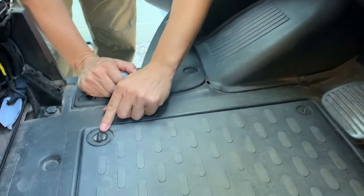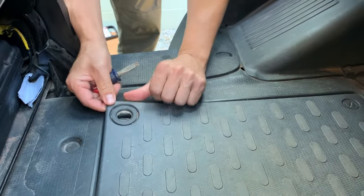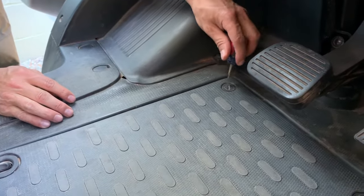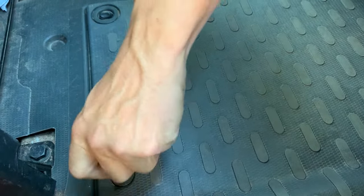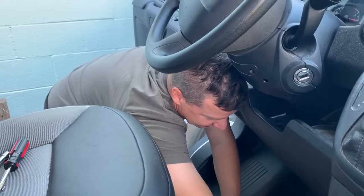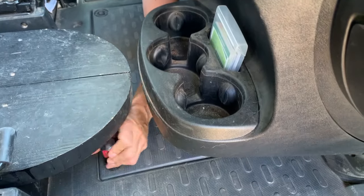The first thing we need to do is locate the battery. It's on the driver's side on the floor, and we're going to remove that cover so we can access the battery. The only tool we're going to need for that is either a quarter or the little stubby screwdriver. The first one here, all we have to do is turn this button 90 degrees to where it will lift up. Then we'll go to the little plastic threads or the screws and give those a turn until they stop. This is where the stubby screwdriver or quarter comes in handy because these areas can be hard to reach.